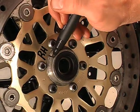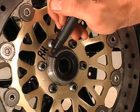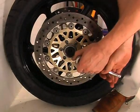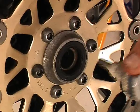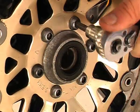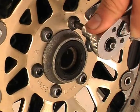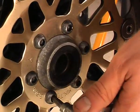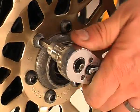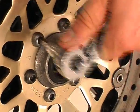When I remove disc bolts, I use gravity and friction to my advantage. Roll the wheel against the wall like this and wedge it in with your leg. Then, working on the left side, crack off each bolt working in a crisscross pattern, just like wheel nuts on a car. Because you are evenly releasing the pressure on the disc bell, it should stop it warping. Just half a turn on each bolt should be fine.